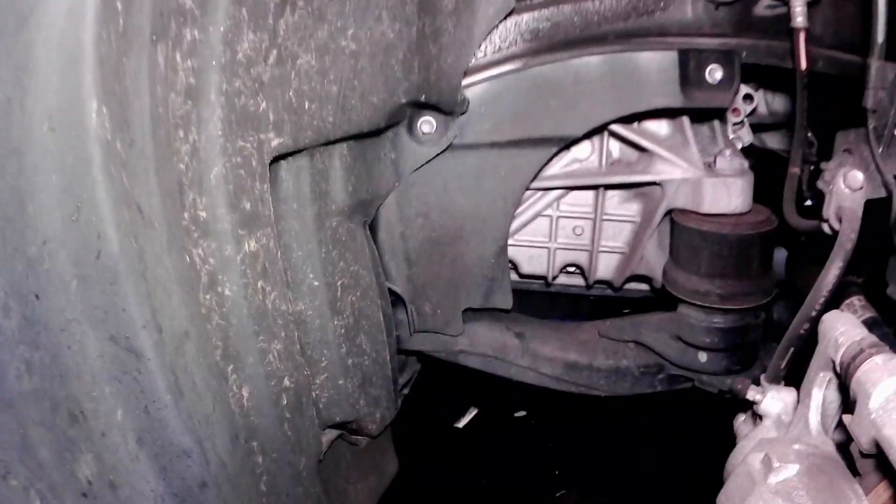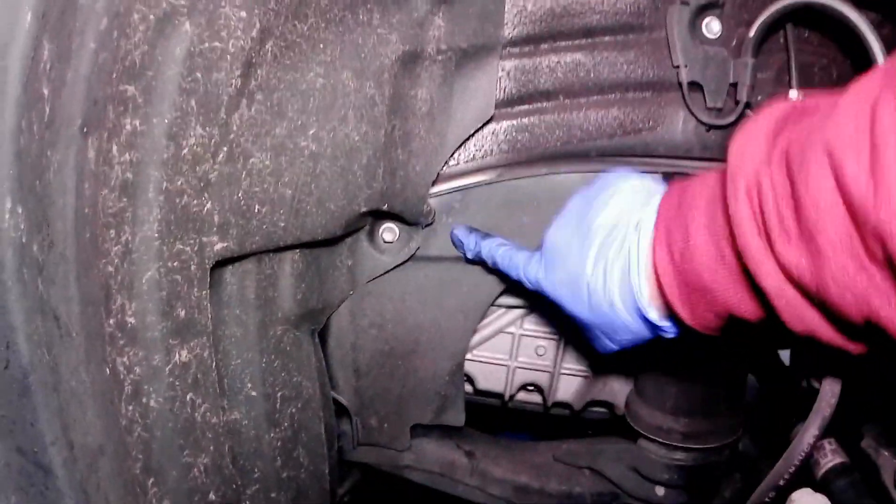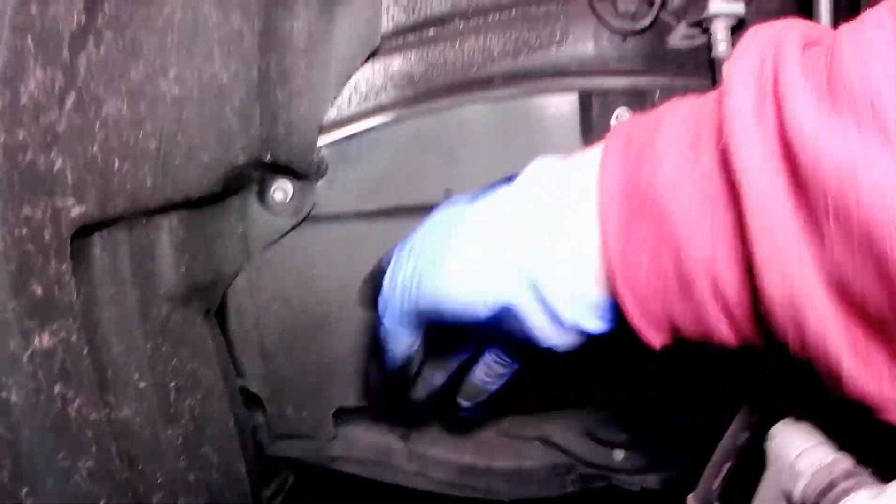The drain is going to be under the car, but the fill plug is going to be behind this panel right here. I have to remove these two 10-millimeter bolts to get access to the fill plug, which is hidden right there. Two bolts came out and this guard comes off like butter — there it is, that's the plug.